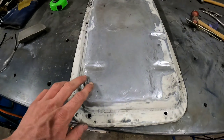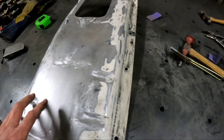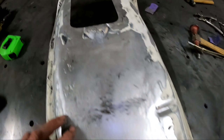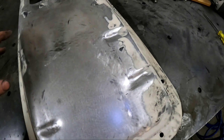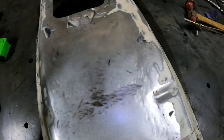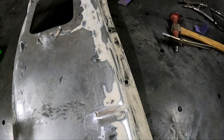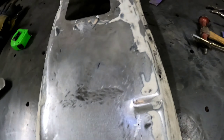So it's all cleaned up and welded. I went further than I thought I was going to, but what I'll do is just prep sole it and prime it with the etch primer — it's not really a crucial piece, so etch primer in a can should be more than fine. You can sort of see that section and then there's the section I've just done. I can see my previous work compared to what it is now — my previous work's got a little bit ordinary in the welds, because what I would have done was just left it in the truck and welded a piece in there, would have had oil and stuff underneath. It's a bit warped and everything, but I've straightened it out the best I can.